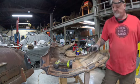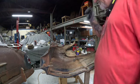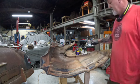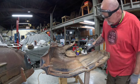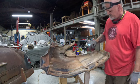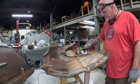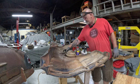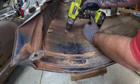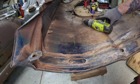What's going on with the fender is it still has some nice SS trim on it. So I'm going to remove that mostly just to clean up these fasteners. I'm not so sure I'm going to put it back on, but I might. Some of the cage nuts — sheet metal nuts, whatever we want to call them — the nuts started spinning, so some of them broke off. I managed to save the bolts though. Pliers or vice grips worked to grab the nut in some cases, but there was no way to get vice grips up inside with the inner fender still on.